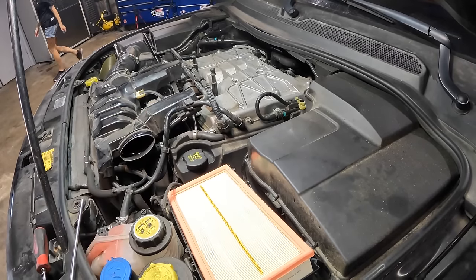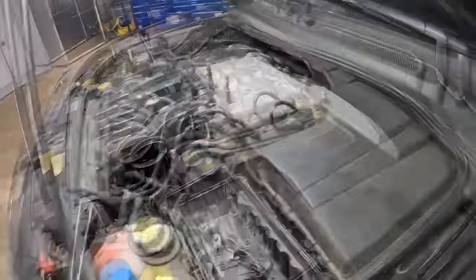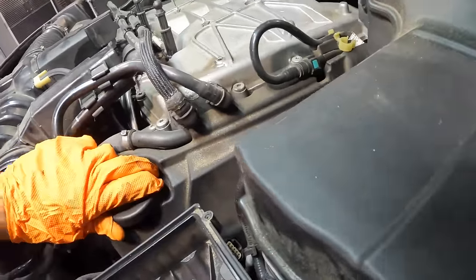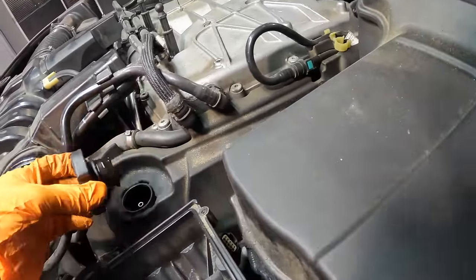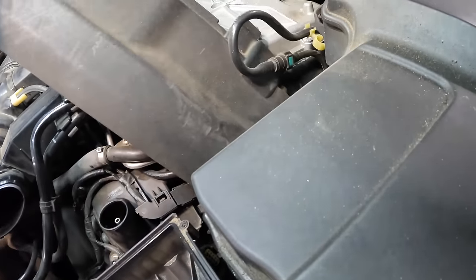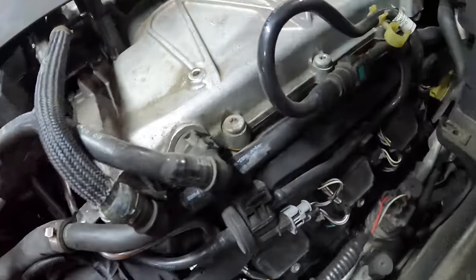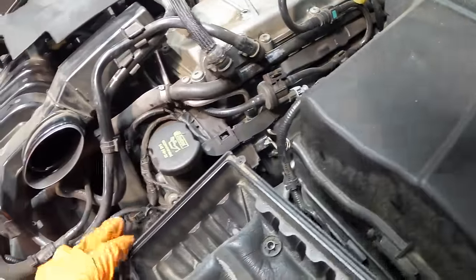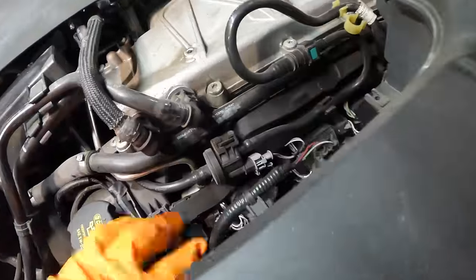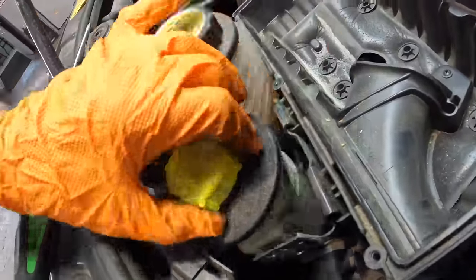Ovular clamp. All right, air filter — look at that, brand new. Let's move in a little closer here. This is our little molded foam type of deal I was talking about. Let's get our oil cap removed and hold this guy back — and there are our coils. Four on this side, four on that side. We're going to need to go in there with some Torx bits, pull those guys out, and then we can extract the spark plugs. I've got the power steering reservoir detached from the air box.